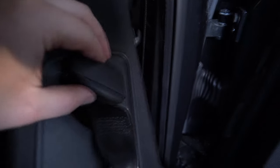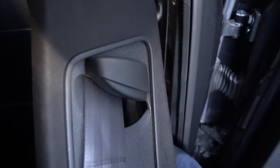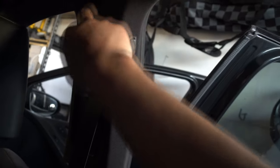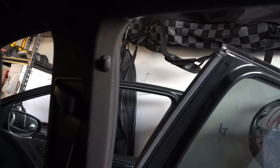Next thing to do is move this all the way up — make sure it gets all the way up. Move this one all the way up, and then put that on and make sure that square right there goes into that square. After you get this put in, you should be able to squish, move this up and down, and it'll move that buckle up and down. Then tighten that screw up. After we get the bottom screw, the belt is fully in place — make sure the belt moves nice and smooth. If it doesn't and it's binding, there's a problem. As you can see, she's just going like she does. Next thing is put in the one screw up here. If your airbag trim piece is good, you can put it up here, or if you have to modify it because those little forks tend to break really easily. If all fails, you can always grab some from VW. Just make sure this is sitting like it should — you might have to squeeze it up a little bit.